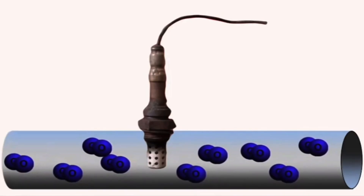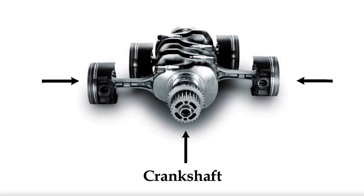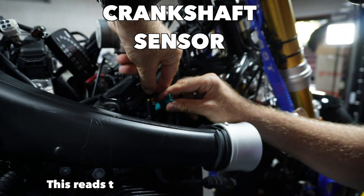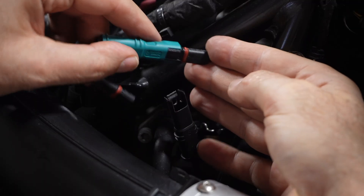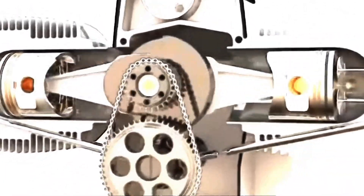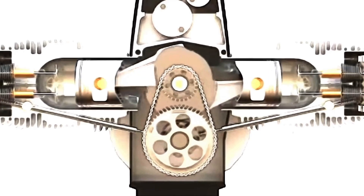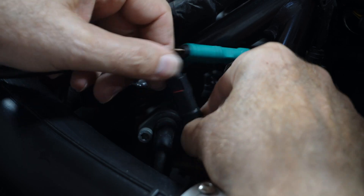The O2 sensors on their own don't get anything moving — that is partly down to the crankshaft. Hence we have a crank sensor, which reads the crankshaft position signal. It detects the position and rotational speed of the crankshaft, which converts up-and-down motion into rotational motion. This is detected via changes in the magnetic field as the shaft rotates. This information is also used in adjusting ignition timing.